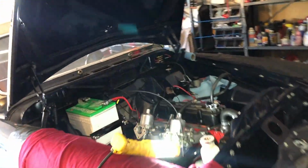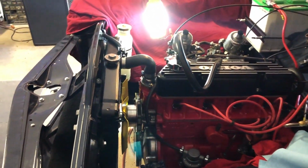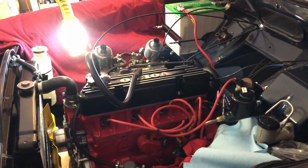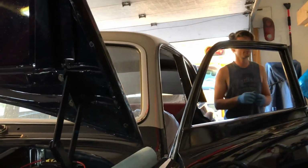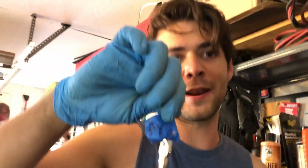All right, Sari is here to help me with the first start. Gonna need a little more enthusiasm from you there. We put in brake fluid, which is not necessary for the first start. There is some gasoline in the back. First gas in a new tank, oil's in, slight coolant leak from the water pump where it seals to the head, and it stopped dripping after maybe two or three glasses worth of coolant, and it's ready to go. We're gonna crank and crank, get some oil pressure in, and then eventually gasoline will come, and with that hopefully some spark too. Some of the connections are tentative, like the PCV valve. We're gonna hold back judgment because I have to be out of here in 48 hours. This is my label for the keys. Like, that's how bad it's getting.